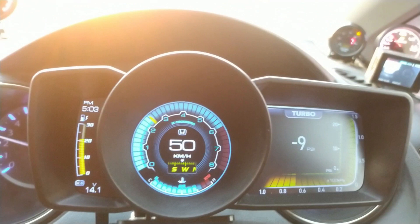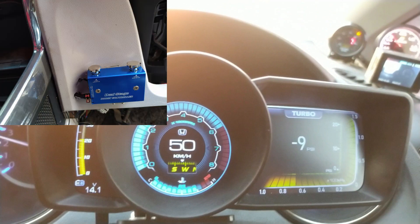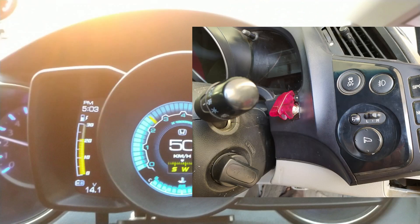If you set the low boost to 8 clicks, you start the high boost from 8 plus — for example give high boost 12 or 13 clicks. If not, the high boost won't give more boost than the low setting. The boost controller has a solenoid — it either operates through the low boost or the high boost, so the high boost clicks must always be more than the low boost settings. That's why when you toggle up the switch, the boost will be more.